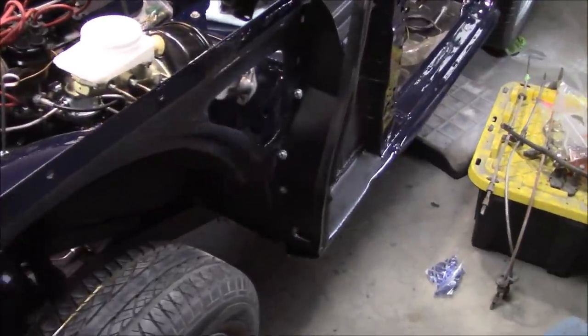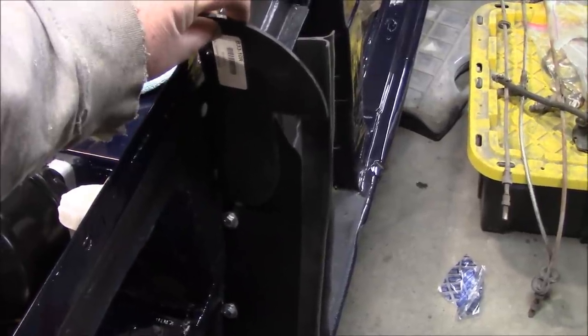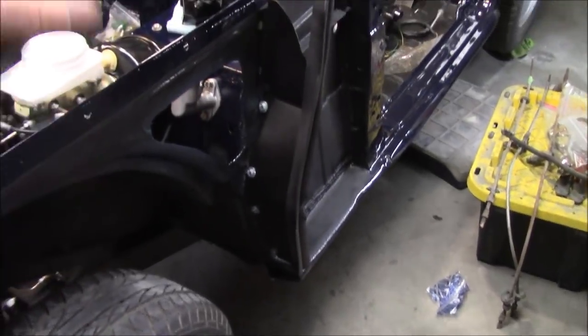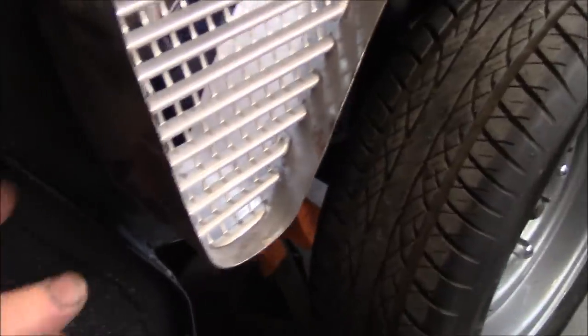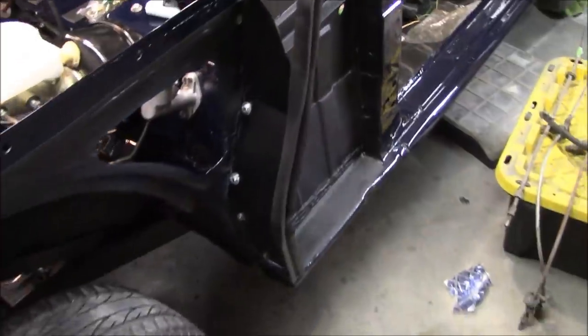There's the plate installed on the driver's side. We'll need to trim the seal a little bit — it will attach at a later date once we figure out how high or low it needs to go. We'll probably also need a little bit of seam sealer at the bottom. When I got this car, it did not have these plates installed, and we had to weld on the flange to even hold the seal. Lynn bent those up and welded them on so we could install these — if you can imagine this whole cavity behind the wheel being open right to the A-post, that would not have been a good thing.